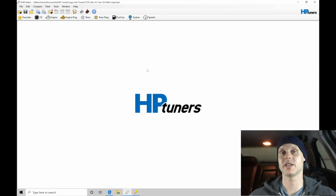Welcome back to our live training session here with our Cadillac CTSV. In our last video, we learned how to create our base calibration file, we've uploaded it to the ECU, and now we're in the status, we're ready to fire up our engine and start our calibration process. This video we're going to be focusing on doing our idle control tuning, making sure that we have everything sorted out so the engine's going to start up and hold its own idle, making sure that all of our idle trims are worked out, making sure that we're going to be able to free rev the engine, it's going to come back into idle properly, and then we can move into the calibration process looking at doing the actual tuning on the mass airflow and the speed density operation.